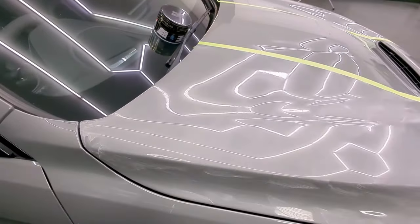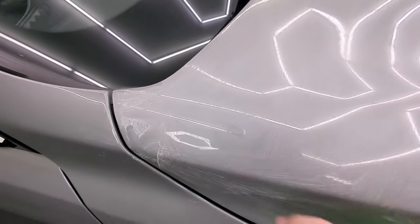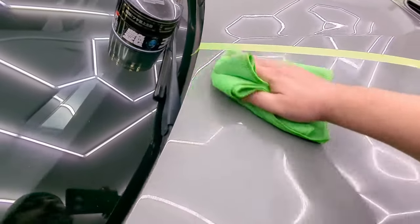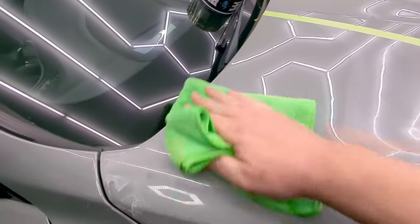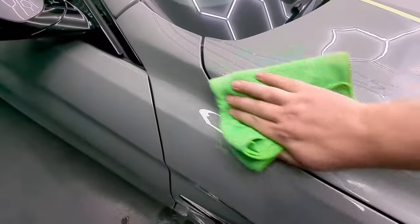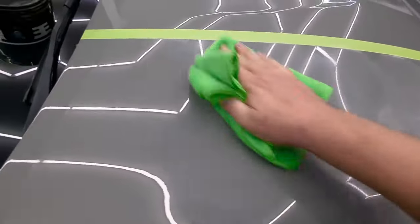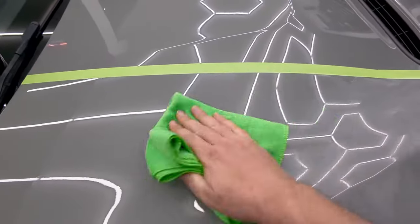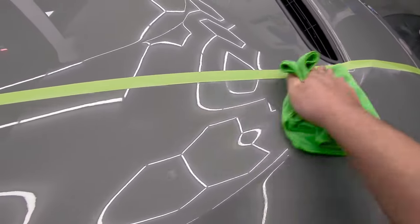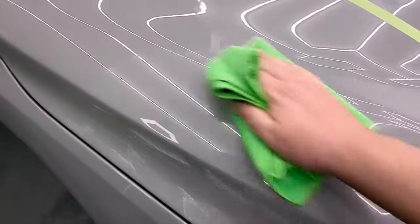The King of Gloss has been on for just under 10 minutes and we're looking for that dry cure — when we swipe it we know the wax is ready to be removed. We've got a clean microfiber towel and we're just going to buff the product off, shining up the paintwork in gentle circles. If you put this on nice and thin it'll buff off with less pressure, which is what you really want. Don't put tape on your car when you're waxing because you always get a line — I'm just doing it for the demo.